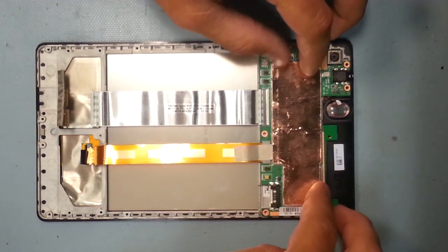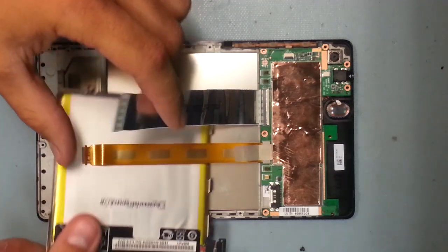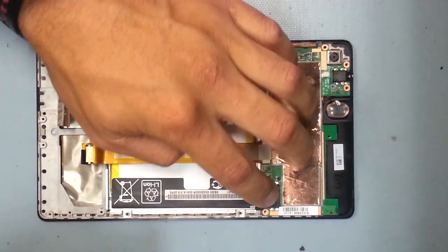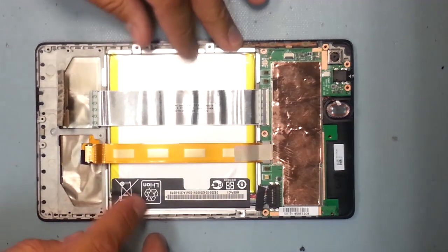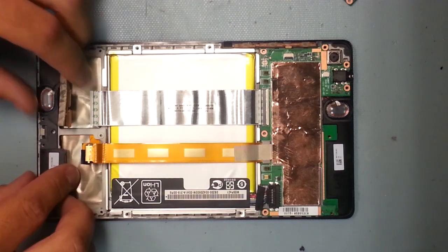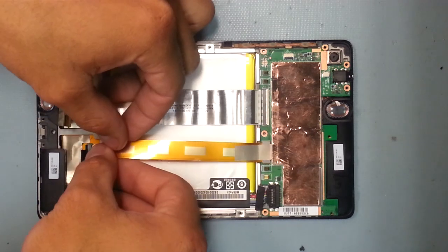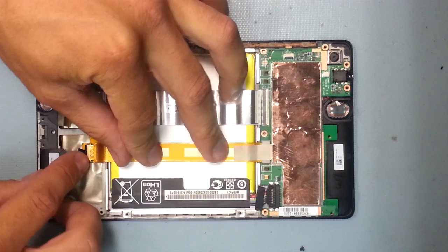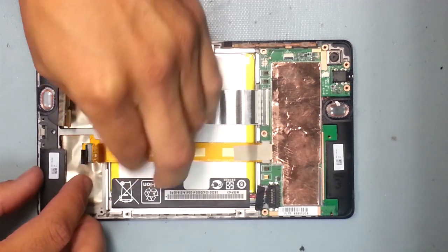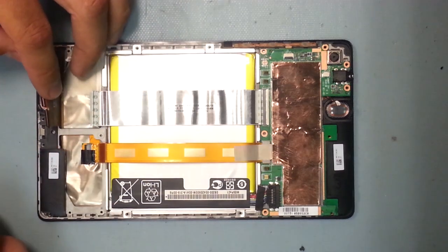Putting the speaker and the motherboard back into place is pretty straightforward — just make sure all of the ribbon cables are on top of the motherboard as well as the little speaker wire, so you're not digging for them later. Clip the battery back into place and set in the bottom speaker. Make sure all the wires are up and out of the way so you can plug them in. They do have two little tabs on either side that you can use to press the connector into the latch.